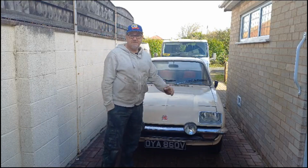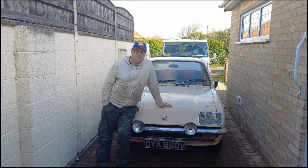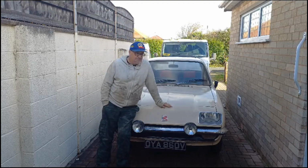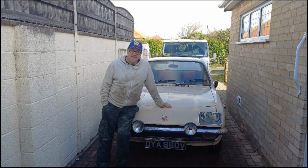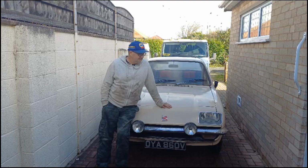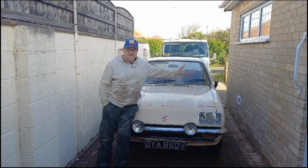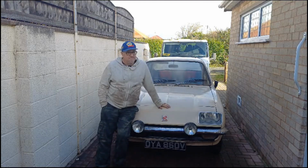As you would have seen in the last video that we just put out, we believe Oddy got a problem with the car because it was running a bit rough. We cleaned it out, as you saw, got rid of the bits in it. But no, still having a problem. So did a bit more investigating and noticed we're getting an intermittent spark. So I looked to the points, cleaned them up. Cleaned all the leads up to the condensers and onto the coil. Still having problems with it.